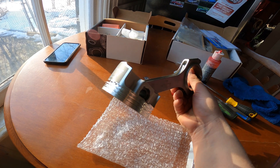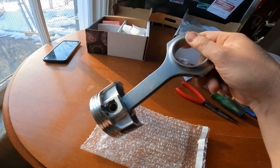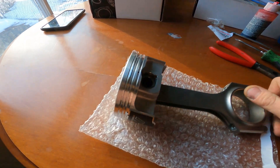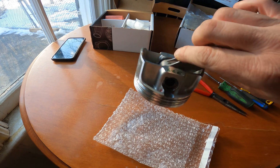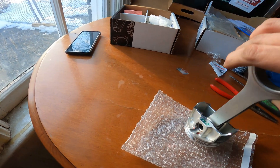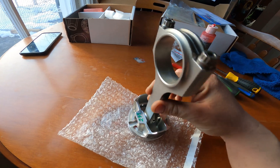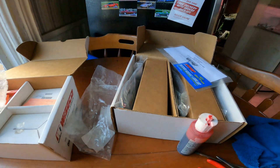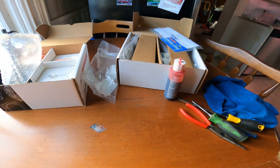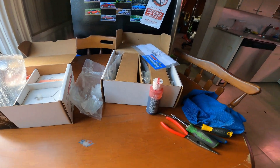That's the first assembly for the Ecotech - Wiseco forged piston and an Eagle H rod. A little bit of assembly lube in there to make sure she spins free. And one's done - three more to go. Let's get these suckers built and ready to go into the motor. Like I said, three more to go, so I'm going to put you all on time lapse - let's get into it. Get it done. So we've got four slugs sitting there waiting to go into the motor.